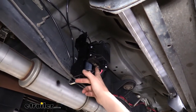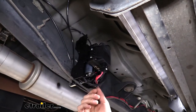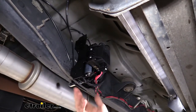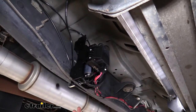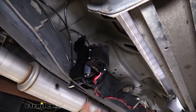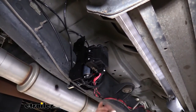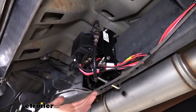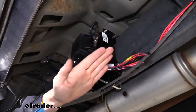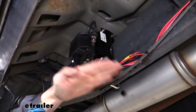This is a dual channel compressor system, so it will work independently side to side. If you've got airbags in the back, you can control the driver or passenger side independently from one another. This is nice if you've got any uneven loads — maybe one load you've hauled in your trailer was really large but extremely light, and the load on the other side happens to be also large but very heavy. We can use our compressor to compensate for that extra weight on one side.